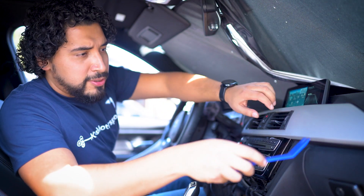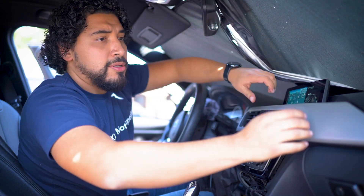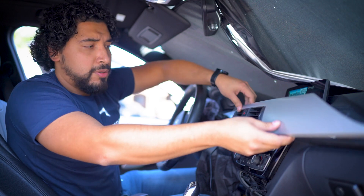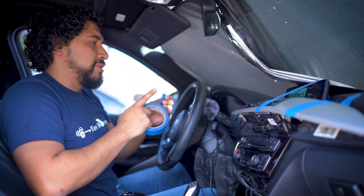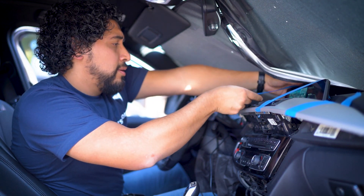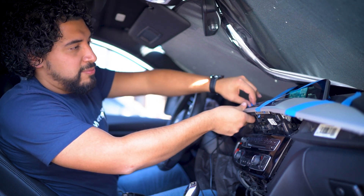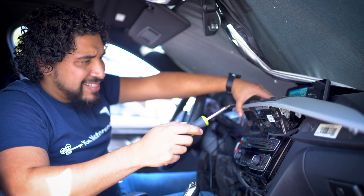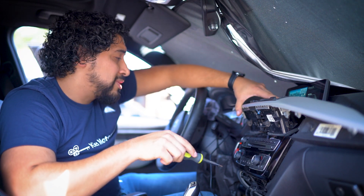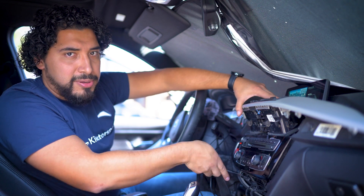With your trim tool, you're going to want to just pop it up — this back part over here seems pretty fragile. What I like to do is get some painter's tape and tape it on the back end of the iDrive to hold it while you work. We're going to start to unscrew the T20s that are on each side. I'll unbolt the two on the right fully, and the ones on the left-hand side I don't have to take off completely because there's no need to unplug it.